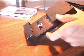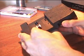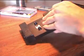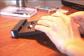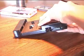And when I opened it up, I found out there was a fiber belt inside that was falling apart, all the strands. With the method of ClydeSight using tape, I tried that using the type of tape that's used in packing on a package to strap the boxes together. It works okay, but the speed isn't the most constant, as you noticed.